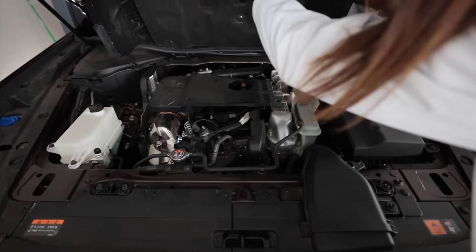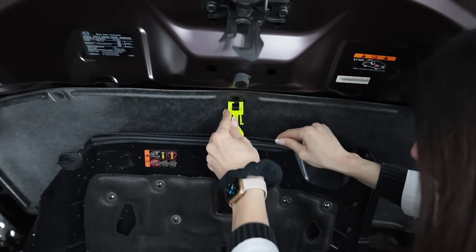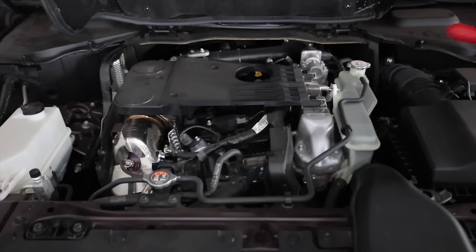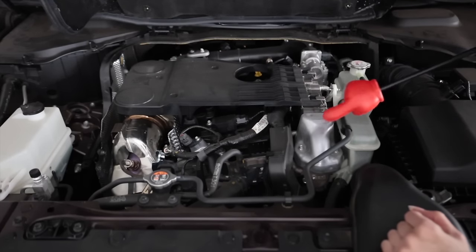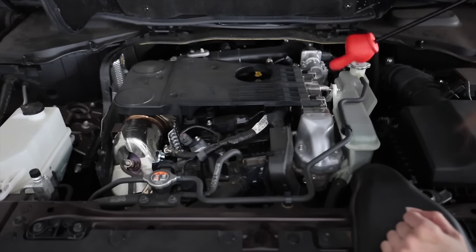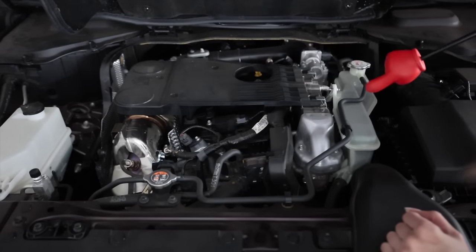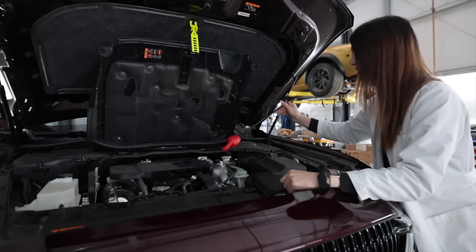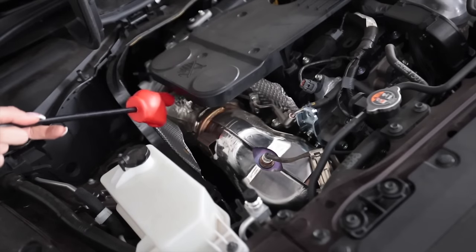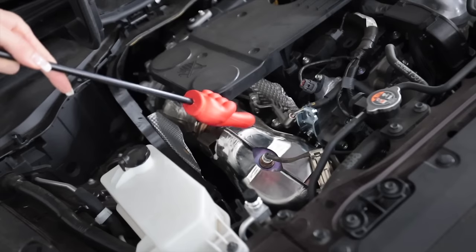Let's get a look at this engine. There's quite the cover — someone at Mazda was using their noggin with this design. There's also a little plastic cover here, but you can see the water-to-air charge cooler right on the side of the engine, with a coolant inlet and its own expansion chamber. That explains the side heat exchanger — it needs its own if it has a separate coolant expansion chamber. You can also see the turbo module right here on the side of the engine; it's got an integrated manifold, and the down pipe is facing forward.